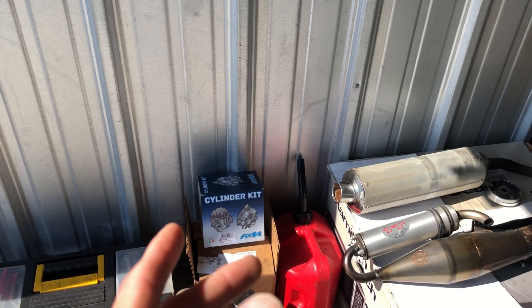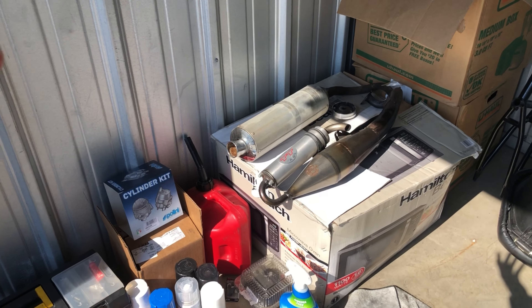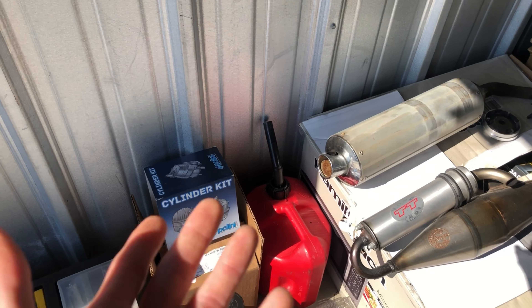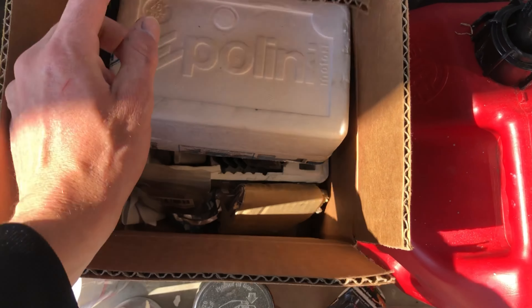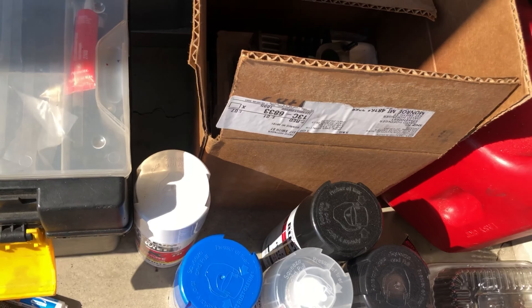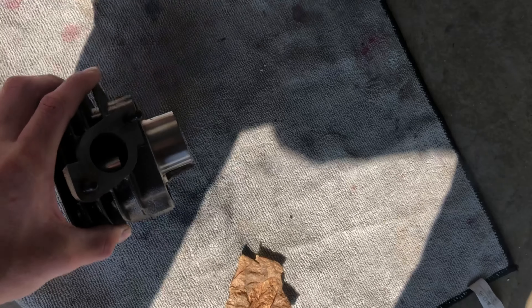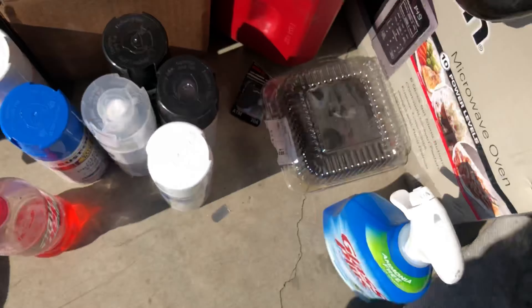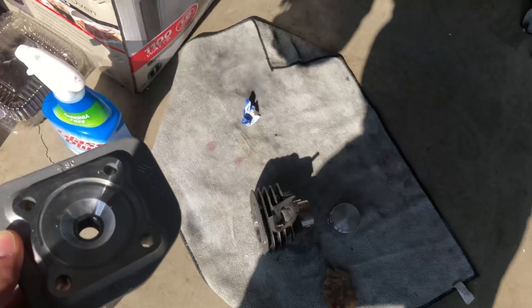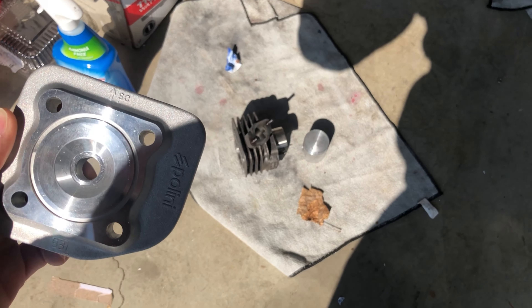I have a subscriber named JW — you know who you are, bro, you've been around since day one. He had a question last week about the valve adjustment on the four-stroke and asked if the same concept applied to a two-stroke. It simply does not. If you guys don't know this, a two-stroke does not have valves, does not have a camshaft, none of those parts. The simplicity of these two-strokes is this: the whole top end is just your piston, your jug or cylinder wall, and your head. Three parts — it's like Legos. Two-strokes are way easier to build, much less time-consuming, but more finicky.